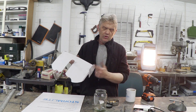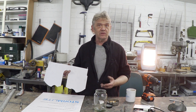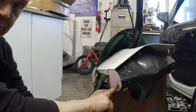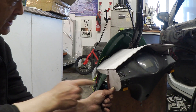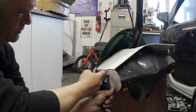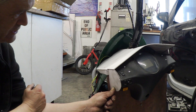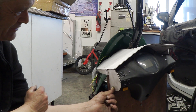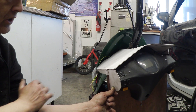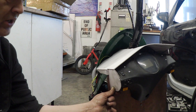It's a little boxy around here at the moment because I obviously haven't finished it, so what I'll do is offer it up and see what the fit is like. Here it is offered up to the instrument cluster — I'm just holding it on because my plan is to put a couple of screws in once it's made. As you can see it's got quite a nice fit and generally does the job I want it to do, but we've still got this slight boxiness. We can take care of that with body filler — body filler and a liberal amount of sanding will round off and give these much more of an organic curve.